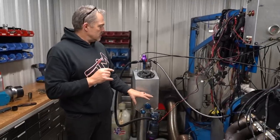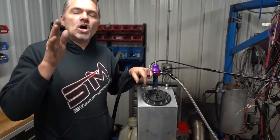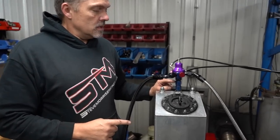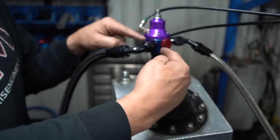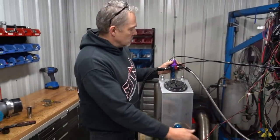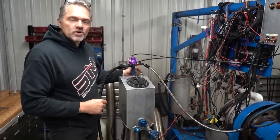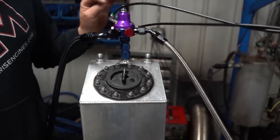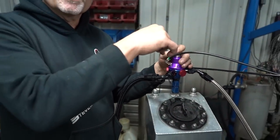Fuel pump. Now this is just the dyno cell, okay? Your bypass style regulator, always, always, always, without doubt, without any excuse, the return needs to be in a car. When you have a hose on here, the return to your regulator has to be bigger than the inlet line. Okay, that doesn't mean you just go make a smaller inlet line. So what Kyle had set up here, because Kyle didn't know, was he had a dash 10 line coming up to the regulator and had a dash 8 return line, just a dash 8 that was just a little nipple right here, all right? And what it does is the fuel pump pumps so much fuel that the regulator can't get down. The minimum amount of fuel pressure we could get was 10 PSI.